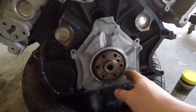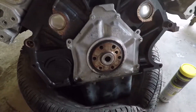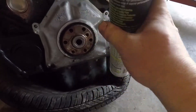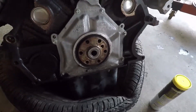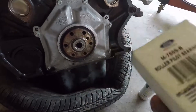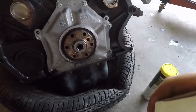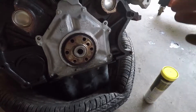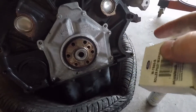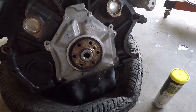Pilot bearing's in. It sits just about flush — you should feel movement in the actual bearing itself. I'm going to grease it with some standard WD-40 multi-purpose grease; I've used it in the past, it's pretty good stuff. The pilot bearing for these is an M-7600-B. These fit 96 all the way up to 2017, so you can't really go wrong. It's a pretty straightforward job — it can be a little tight, but you shouldn't have to use heat or any major force. Just tap it in gently and evenly, otherwise you get it in cockeyed and may ruin it. Let's grease it up and get this clutch put on.